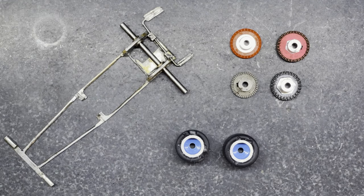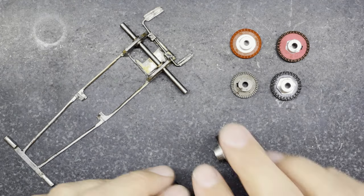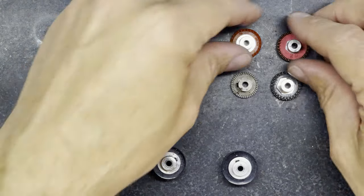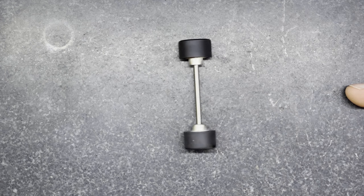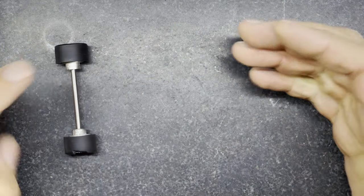Now the car only has to turn left, so there is a thought that I could put the larger tire on the outside. I'll move these out of the way - I've put the larger tire on the right-hand side of the axle, if the car was traveling in that direction. I'll push the axle and you can see what happens: see how the axle started turning left and keeps turning. That's because this tire is bigger than that tire, and that causes the car to attempt to drive to the left.